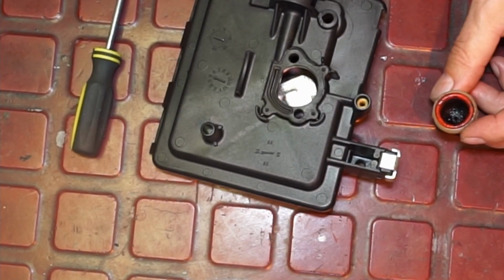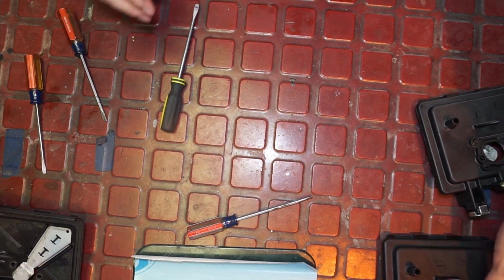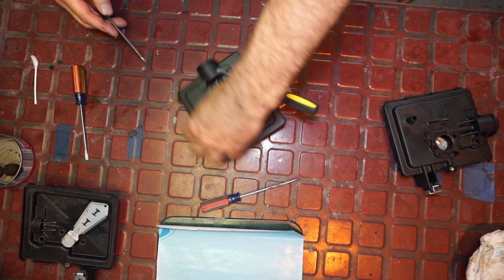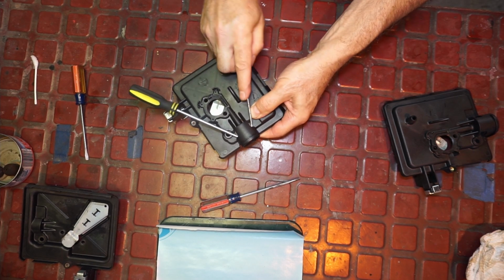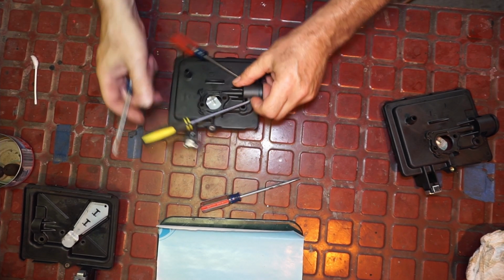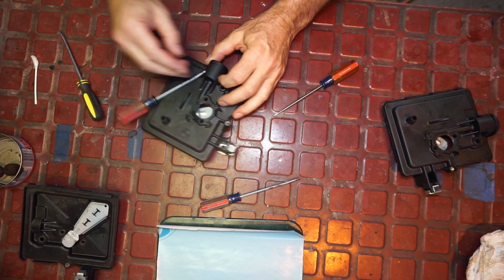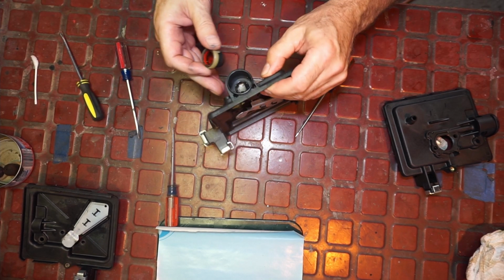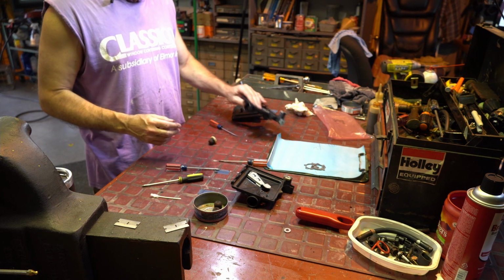Right, you want to be blowing that out, not in your carb, because it's going to get clogged in the passage here, and it's just going to be in the carb. So we're going to clean those out in a bit. Let me just do this one too. And it doesn't matter if you clean the outside, the stuff's in this passage. All right, so I'm going to get these out. Like I said, we'll hold it with my fingernail. That's it. It's not hard. Oh, see the gook in there? I don't think you can see it with that camera on my right.